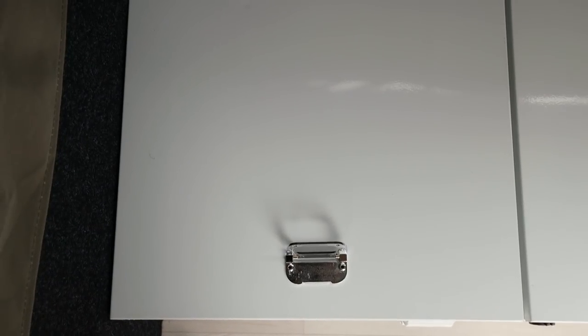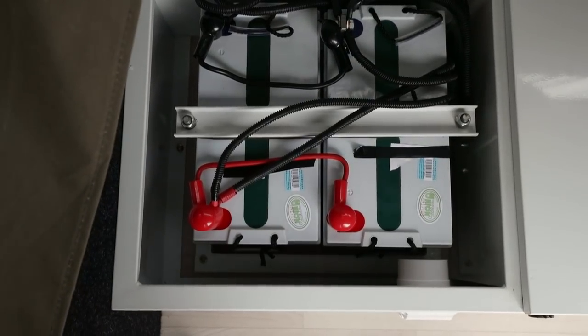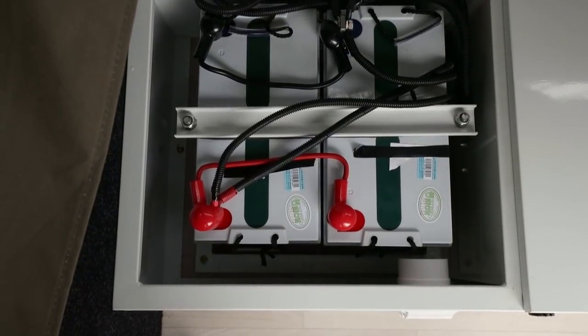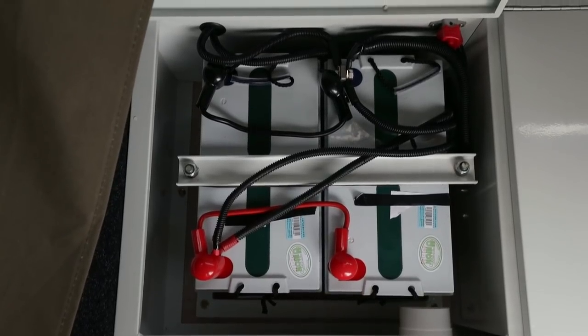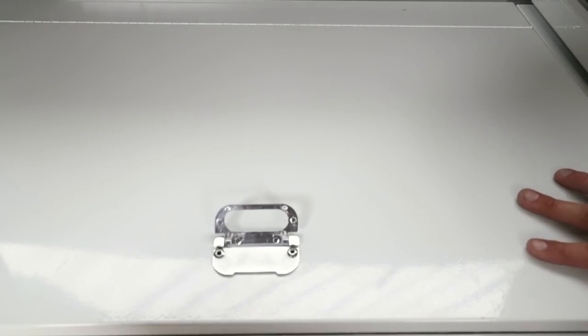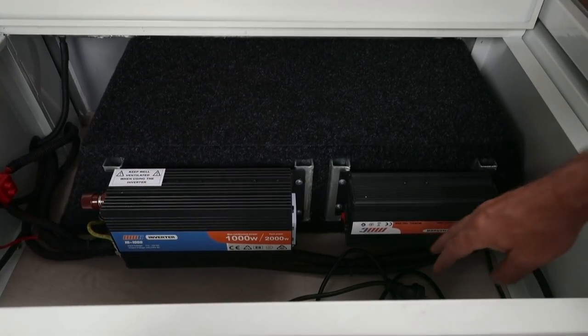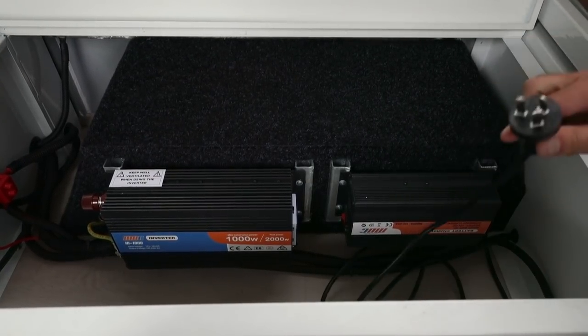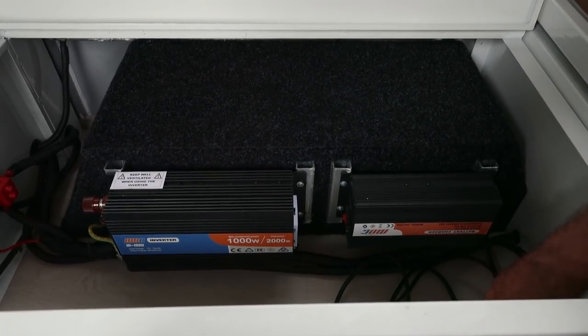In your Cruiser Slide, under this little door here, you're going to find your batteries — they're two 100 amp hour AGM batteries, nicely fixed in there and linked in sequence, so you've got plenty of battery power. Under this door here when you lift it up you'll find the battery charger. It's a 240 volt battery charger — you've got your power lead there, simply feed it out the hole at the bottom, plug it into your power at home and away you go.